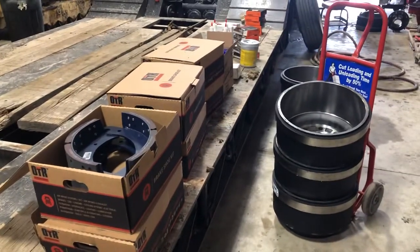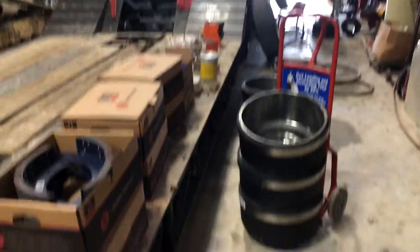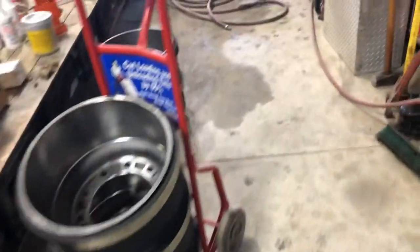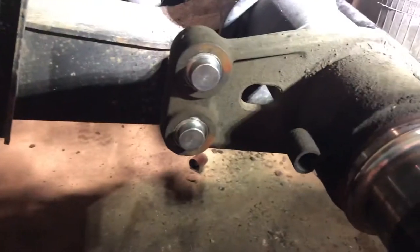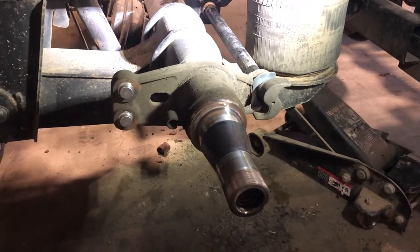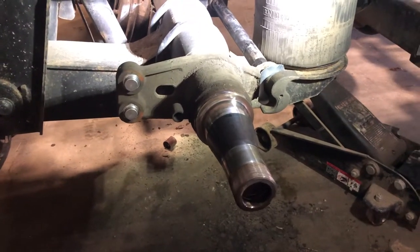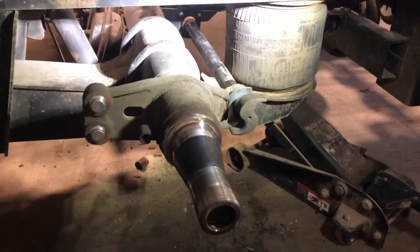What's going on, ladies and gentlemen — Junkyard here. I'm doing a brake job, which made me think about sharing a few things. The first one that came to mind: in 20 years of doing this job I just got one of these air hammer bushing tools and just did my first two bushings. I should have bought one a hell of a lot longer ago — it's so quick. Put it in, buzz them out, rattle the new ones in. Easy peasy.